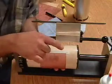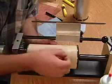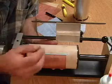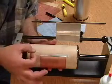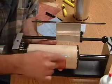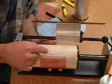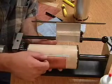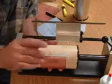Now this here will take about 5, 10, maybe 15 minutes to dry. You want your plate edge to stay down at least 10, 15 minutes before this stuff dries. If you have a very small diameter cylinder and your tape just wants to pop up immediately, that might not be a candidate for this stuff, because if the plate starts to lift off the tape while the seal edge is still wet, it'll migrate under the plate and even aggravate your problem. So you want the plate edge to stay down long enough for the seal edge to dry.